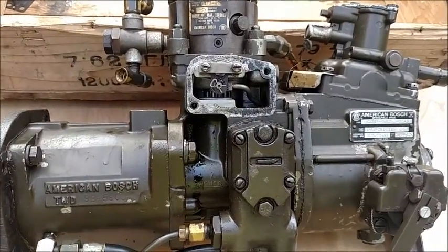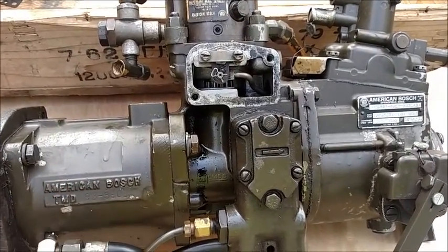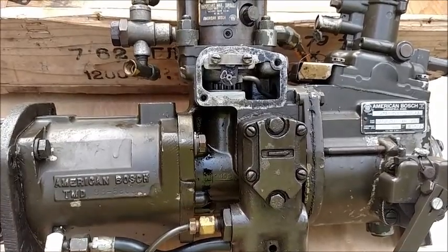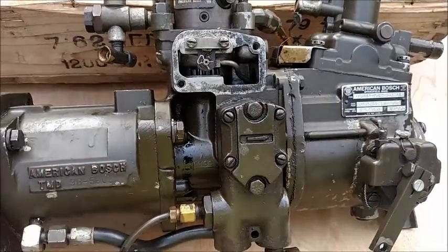When you put a brand new O-ring in there, it is now thicker, fatter than the O-ring that was in there originally, because the O-ring that was in there has been in there for time. It's been worn down, it's been compressed. So this is indeed the correct O-ring. There's nothing wrong with the new O-ring. It is the right size.